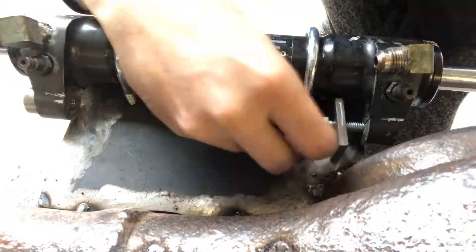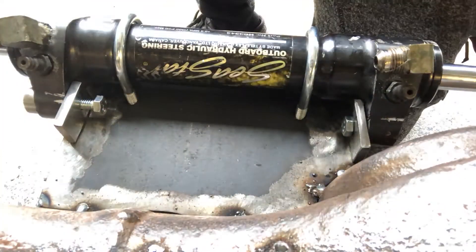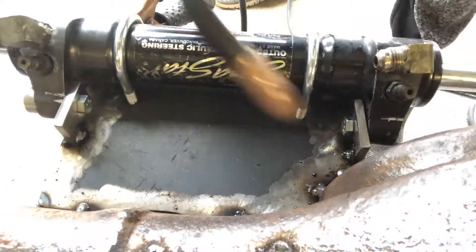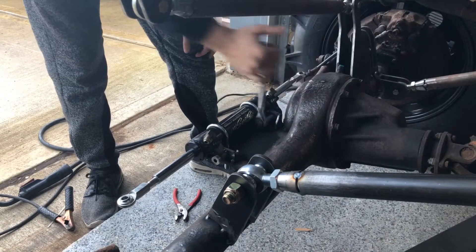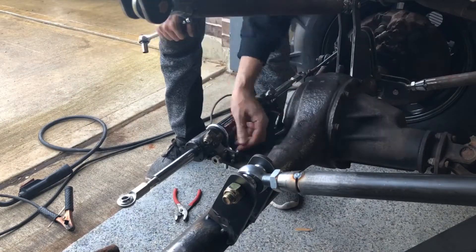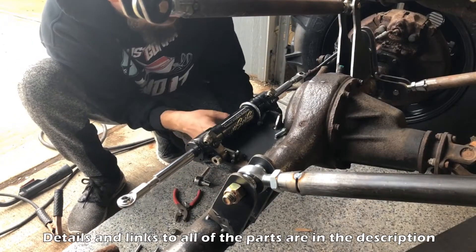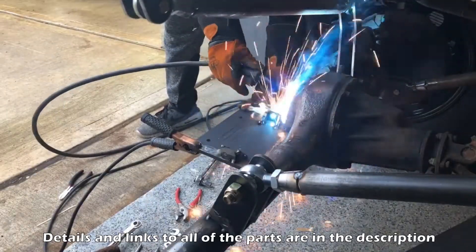For the steering components, it's not your typical hydraulic steering you would see on an off-road vehicle. Normally you would see an orbital valve with a pump and your hydraulic ram. Well, I'm not using a pump. I got a double-ended hydraulic ram from eBay — it's a used one off of a boat — and I bought a brand new boat helm, an off-brand from eBay at about half the price of a Seastar helm, but it's the exact same specs. We'll see how it works out.